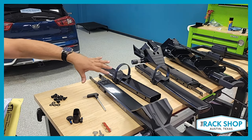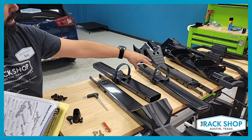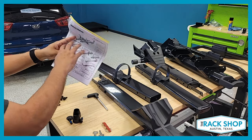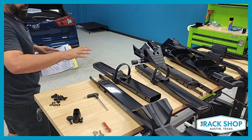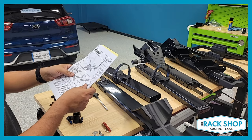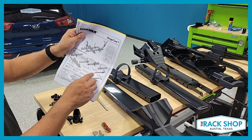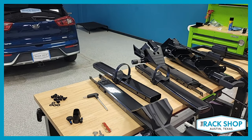Also some hardware for the pivoting arms onto the trays. The trays — I have them currently set where this is the outermost tray, identified by the Yakima logo. That's the inner tray, then you've got the spine and the two ratcheting pivoting arms on the end. You do want to look at your instructions because while some parts look similar, they are different, and you want to make sure they end up oriented in the correct position. Instructions cannot be overstated — read those.